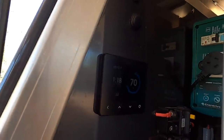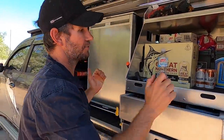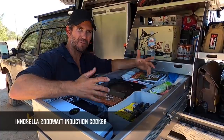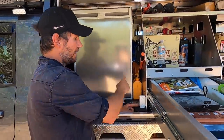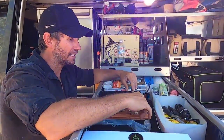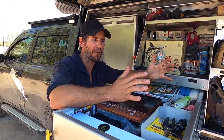That there is our E-Pro 2000 watt inverter. I've gone with 2000 watts because we like to run a lot of appliances and cook out of here without carrying gas. This is my kitchen drawer - inside there's our induction cooktop, a 2000 watt Innobella, only 59 bucks and we've had it two years and it cranks. Just make sure you buy the right induction-compatible saucepans. I've got an extension lead running from the inverter to a double pole socket. We cook in here out of the wind - beer battered fish, bacon and eggs, steaks - no gas needed.